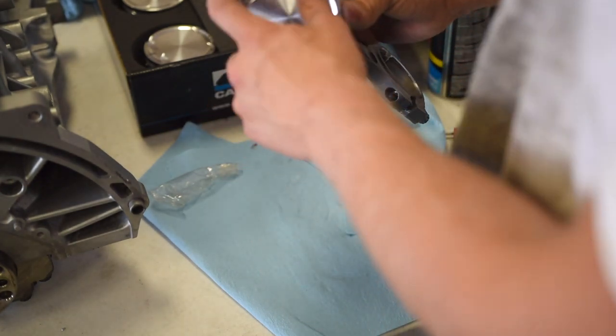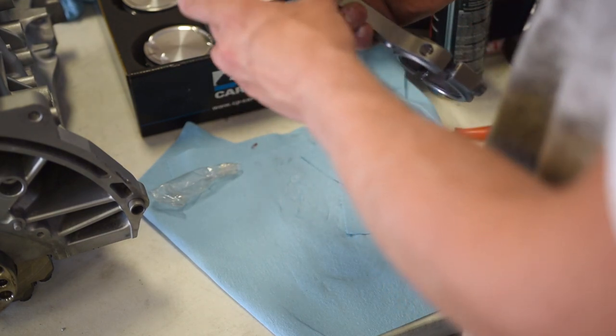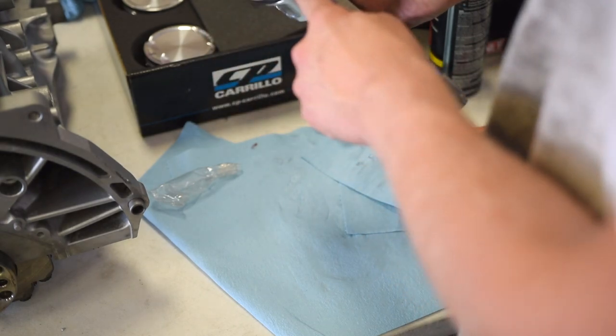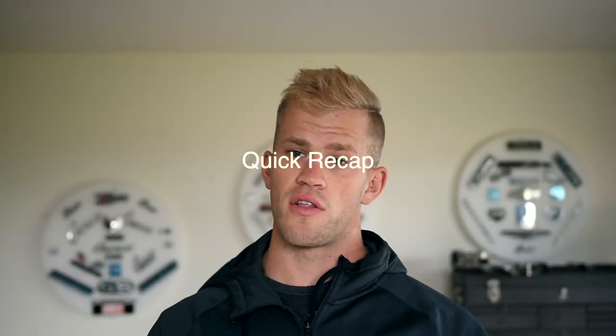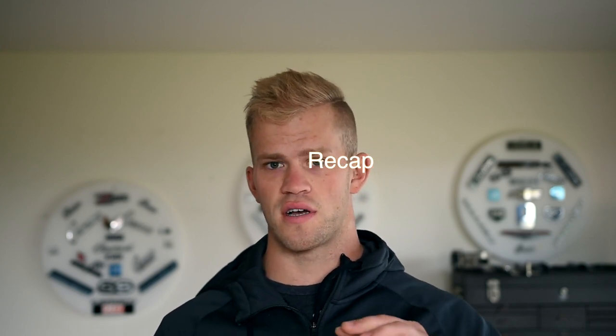Here's a quick overview: the top ring is silver with the end facing up. The middle compression ring — or the second compression ring — is black with the end facing up. Now that we've got the pistons installed onto the rods with the clips in and the piston pin in, all that's good to go. Make sure the rod is on the proper way, and we can now install the piston rings onto the piston. I will have a picture on screen of the piston ring layout showing where the ring end gaps sit on the piston. Very crucial to have these in the proper position — you don't want any of the ring end gaps lined up.